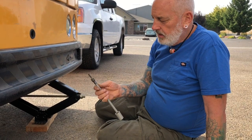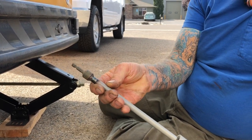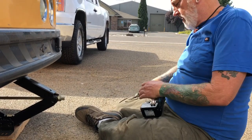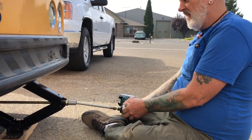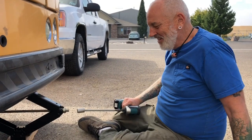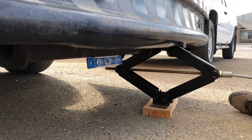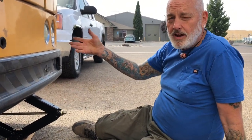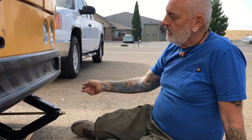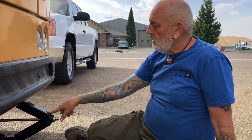The ratchet worked but it was really slow and didn't work great with the load on it using the drill. So Chris TIG welded a socket I had onto a fitting, and now it fits in the impact driver — and it worked really good! I've got my level hanging down here so I can see we need to go up just a little bit. These jacks are not intended to lift the tires off the ground, but they're working with the suspension — the springs are still pushing up but now the jacks are helping push it up farther to level it.